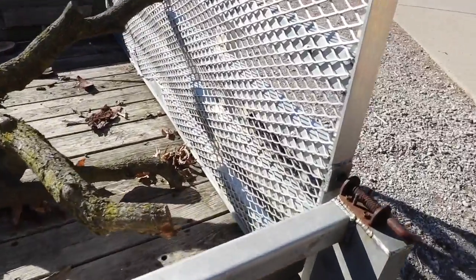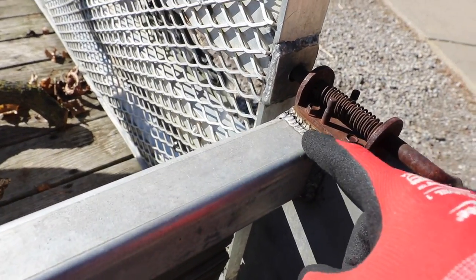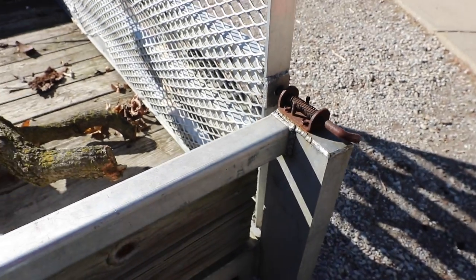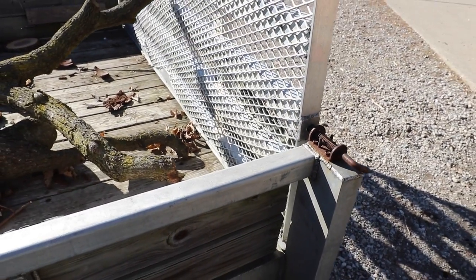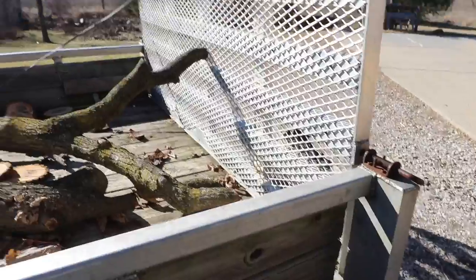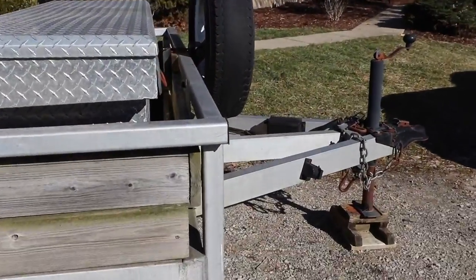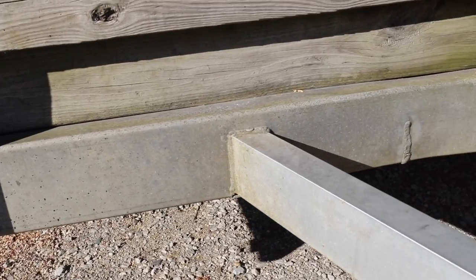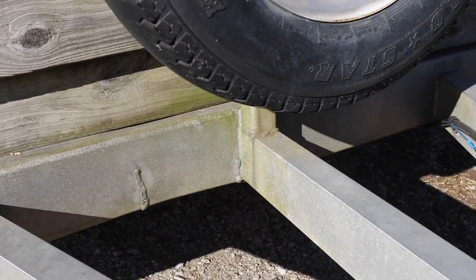I have a little issue right here — it's still holding down with that weld, but it started to crack. So I'm going to bring this in to someone who does professional welding on aluminum and have them take care of that. Then I recommend you check all around the hitch, underneath, and check all the welds.